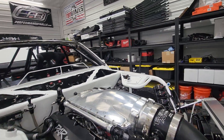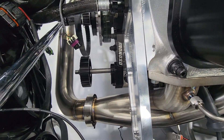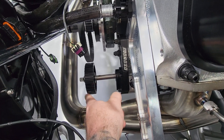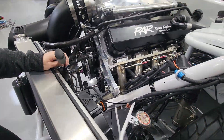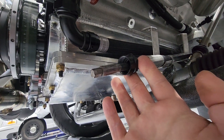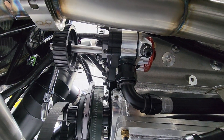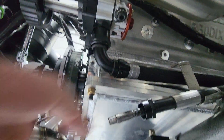A lot of people ask about the cable drive. That's my oil pump — it's run by a belt. Off the back of the oil pump, there's a Waterman piece — that red piece up here — which is a hex adapter for our fuel pump cable. The fuel pump cable will spin right off the back of the oil pump. When I don't want the fuel pump cable to spin, I disconnect this cable here.